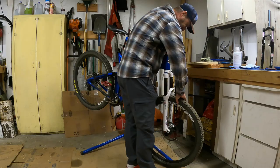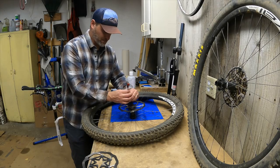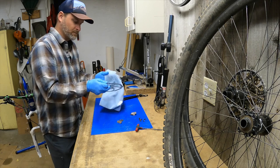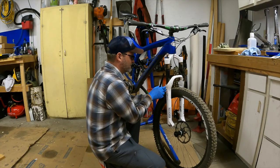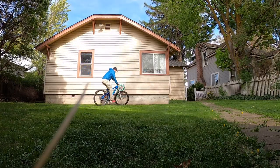Here's a quick recap of the steps I take to clean my disc brakes. 1: Remove the wheels. 2: Remove the brake pads and the rotors. 3: Use a cleaning agent like rubbing alcohol or a disc brake cleaner. 4: Remove any excess cleaner. 5: Reinstall the pads and rotors. 6: Reinstall the wheels. 7: Test those brakes — go for a quick ride around the yard, down the driveway, or through the alley. If the brakes still squeal, repeat steps 1 through 7. If that doesn't work, replace the brake pads. Those are my 7 steps for cleaning my disc brakes.